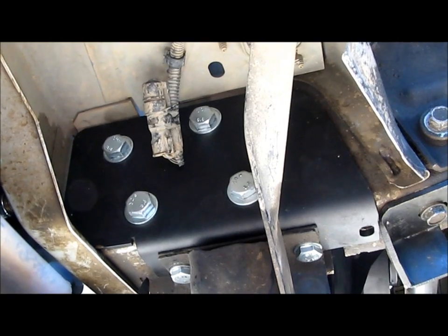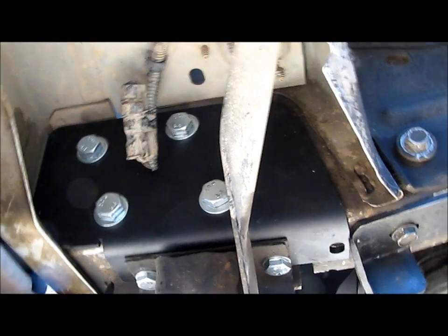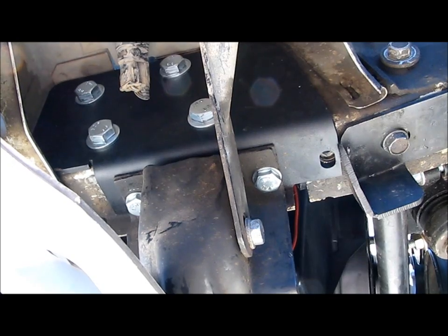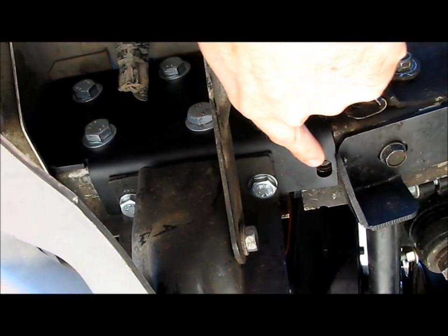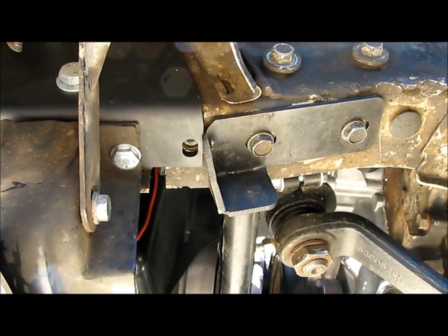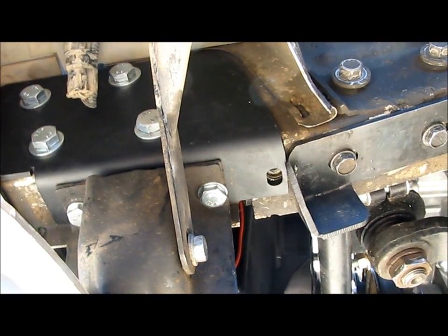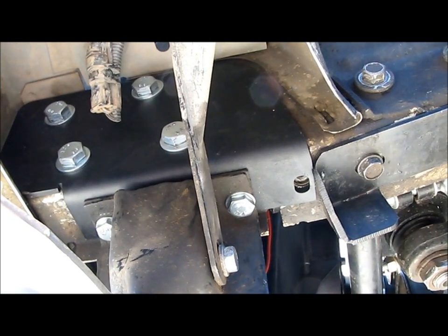But it didn't take long. Cut those out, got them to slide in nice and flush, and then bolted in these. And then you can see it also has 2 bolts on the bottom there. They give you this hardware to replace the stock hardware that goes through the radiator support. And then you can see that 3rd bolt right there. I'm not using that one just because I couldn't get the bolt in with my steering box brace. So if you don't have a steering box brace, run the 3 bolts. Running 2 isn't going to be a problem in my situation, though. I got 6 pretty heavy duty bolts on both sides of this thing, so I'm pretty happy with that.